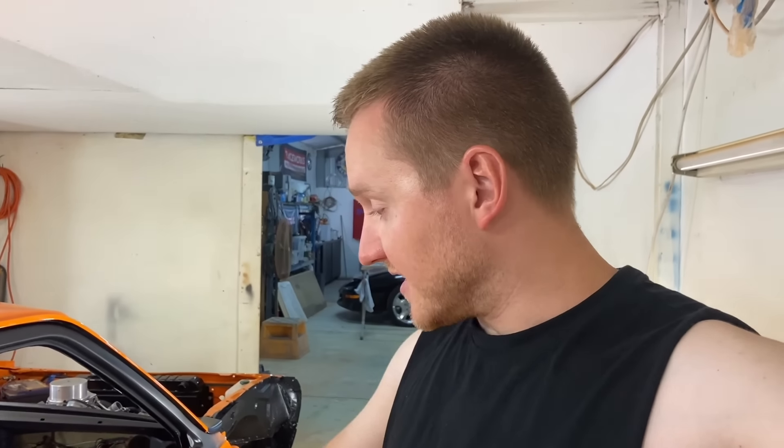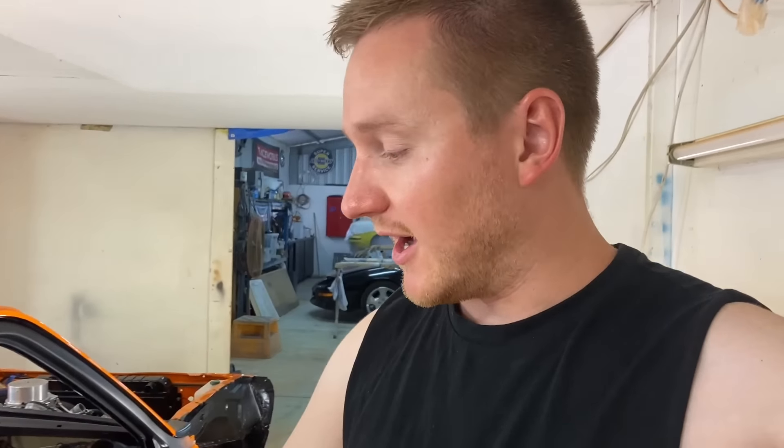In the last video you would have seen the car was pretty much a bare shell with no hanging panels. Now all the hanging panels have been put back onto the car. They were masked around the hinges as well, so that when the doors go back on all of the hinges go back into the same spot. Especially when it comes to doing the blackouts around all of these door frames and the satin black, most of the gaps are pretty spot on. There's a little bit of a discrepancy in the black which you might see, but the blacks on the tops of the doors at the moment is only a little bit of a guide coat — it's not the final tape line, so don't worry if the doors look a little bit out. They're close; they've still got to be gapped 100% yet.